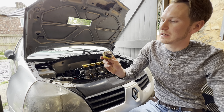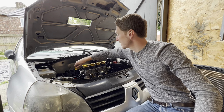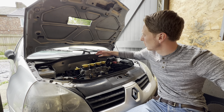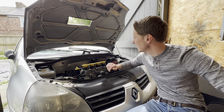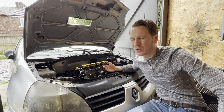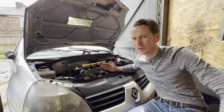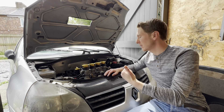This engine is due an oil change for that very reason. By having an oil catch can — which you can see over there — that becomes the highest point on the engine, so all the water vapour, the steam, and the oil vapours rise to the top and get caught in the catch can to help preserve the oil. When converting an engine to running hydrogen gas, you are going to want to do more oil changes anyway, because you're inevitably going to get oil contamination with the water.